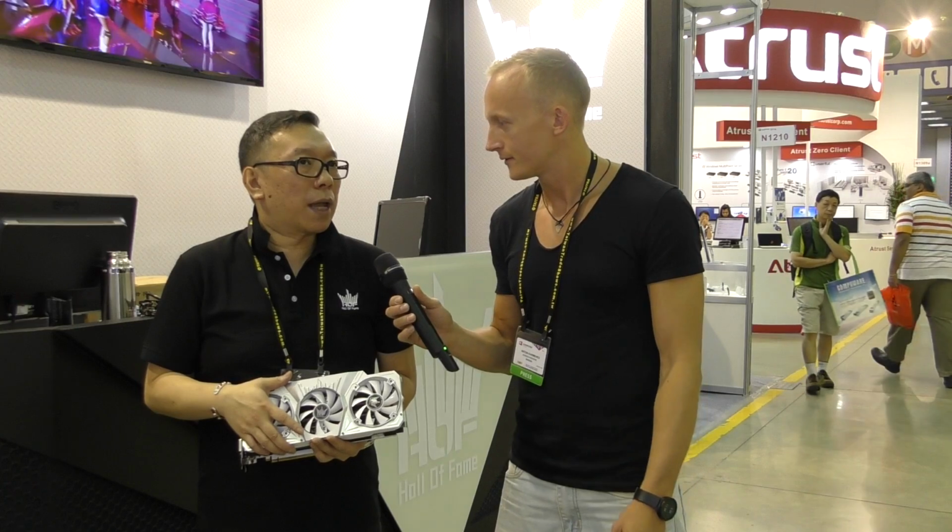As you said, you already reach 2.5 gigahertz here with the LN2, right? Yes, exactly. I managed to push the clock up to 2.5 something, 2.6, and it could run the Fire Strike Extreme benchmark pretty easily at 1.38 volts, with memory at around 5500. That's not too bad at the moment. And I mean these are like the first tries, and you're doing it live here. That's correct.